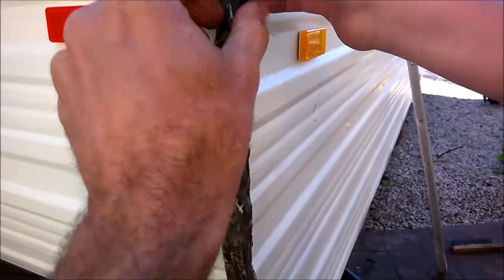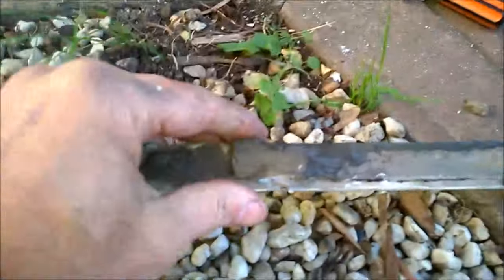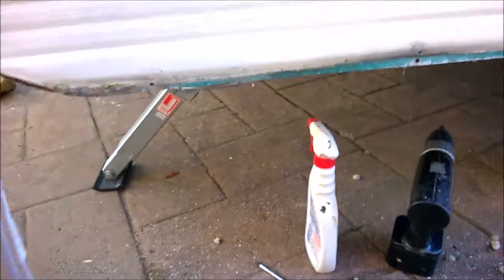I'm going to have to do a bit of cleaning — not just the J rail itself but also having a look underneath, which gives me an opportunity to look at the condition of the chassis. It looks quite good; I'll give it a good clean up. We'll do one at a time. There's also old mastic to take out down here — all hard as rock. No surprises it was leaking. This justifies the hard work to get it all done.